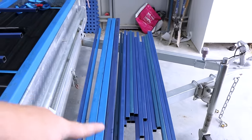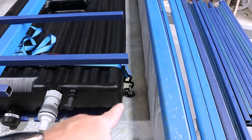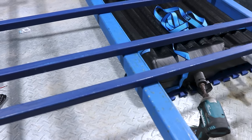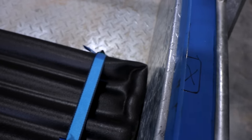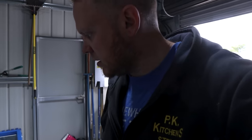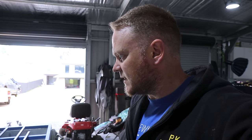Updates: I picked up all the steel today and I've been mucking around with it. Got the water tank in — it's just basically some eye bolts down to the trailer, with big washers underneath to make sure it doesn't pull through. I still need to do all the plumbing. Unfortunately this one was damaged — it came to me with a crease in it already. They're sending me out another one to replace it. As soon as I get that, I'll slide the old one out and put the new one in. I'll put some rubber matting under it so it can't slide around and takes up the little discrepancies in the trailer, and hopefully helps absorb vibrations so the tank lasts a bit longer.